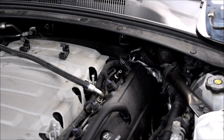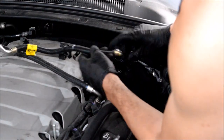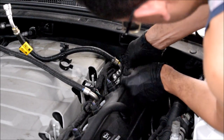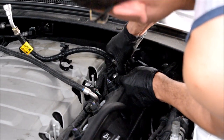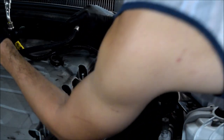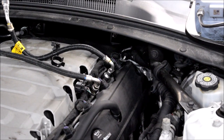Alright, that's off, so I'll go ahead and add my new fuel hose in place of that one. That's not going to go anywhere — but you should still replace the retaining clip. That's not going to go anywhere. Now I've got this and I can kind of just route my E85 sensor to them. I'm really thinking I'll see if I can find shorter GM fuel hose so I can have two short hoses holding that on — it would make a lot more sense than having these long hoses twisted back. But we'll see.